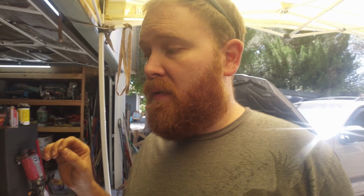I want to keep this swap as simple as possible for you guys, but this is kind of the end-all be-all how-to swap a 4, 5, or 6-cylinder motor into an older or newer vehicle. I don't know why you'd put these smaller 2.8 and 3.5 motors into a vehicle that had a 3.7 in it, but you can do it, and basically I'll show you how. If you've got an 08, 9, 10, 11, 12, you can swap in an 08 through 12 motor into your truck, no questions asked, oil pan to valve cover, drop it in, done.